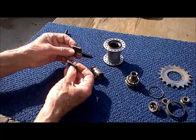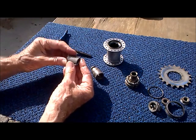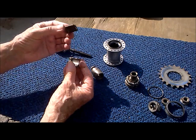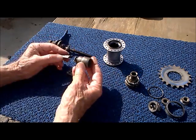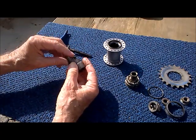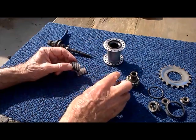These are metal brake shoes — they actually last a long time. I've never seen any worn out, but they do wear out and you can replace them very easily. So the clutch becomes both a brake shoe carrier and a brake shoe spreader. The brake shoes bear against the hub, stopping the wheel.